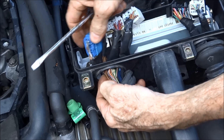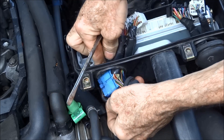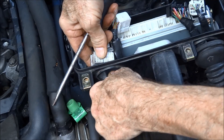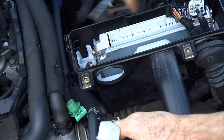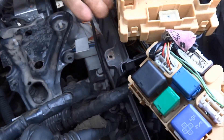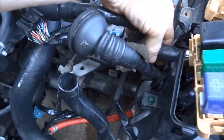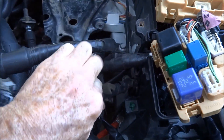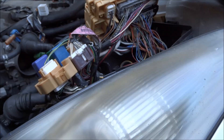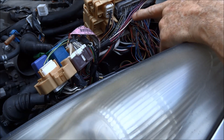These will all come out through this hole one at a time. Just find one that will easily come out first and get it out of the way. Once again, you're trying not to stress these wires too much — same on the other side. When you get these out, you can raise them up quite a ways with the slack that's in the wires coming from the rest of the body wiring harness. I'm going to pull these up higher than normal so you can see them, but hopefully I don't stress any of these wires too much.